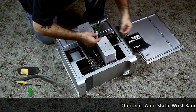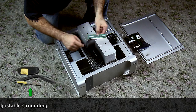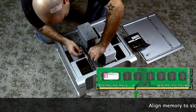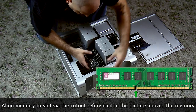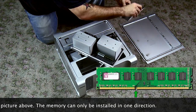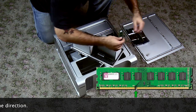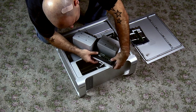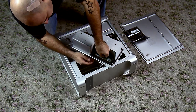Be careful when upgrading memory in your computer not to be electrostatically charged. I have my shoes off here and made sure that I touched metal to ground myself before doing this install. Also make sure to align the memory in the memory slots. There's a small little space inside of the memory that aligns with a little separator inside of the slot. Make sure to press down firmly to click these into place. When done correctly the side tabs will click into the sides of the memory.